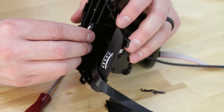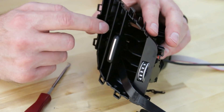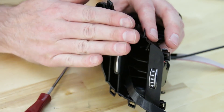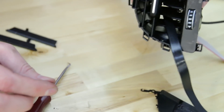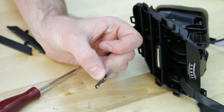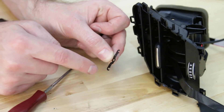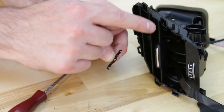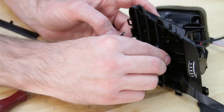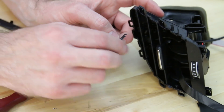What you just saw: we had the two upper vents mounted in place, the center bar in place, and the lower one in place, then got them all the way in, locked in, pulled them out, rotated them out, got the other one slid into place. On the center bar there is a circle and two slits — there is an upper and a lower, so pay attention to orientation. The vent should close and only go up so far. If it operates differently, you've made a mistake somewhere. Then we can put our lower portion in.